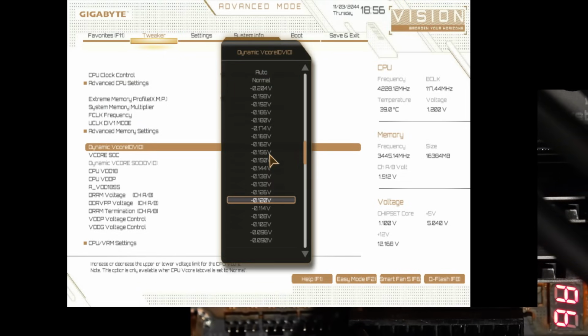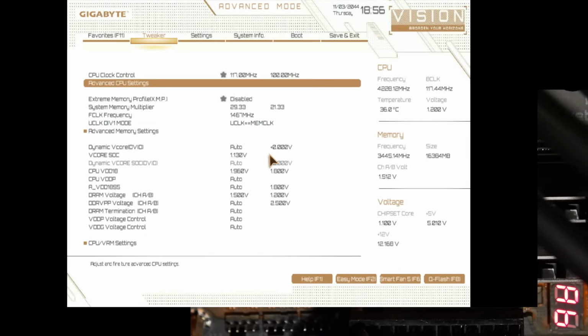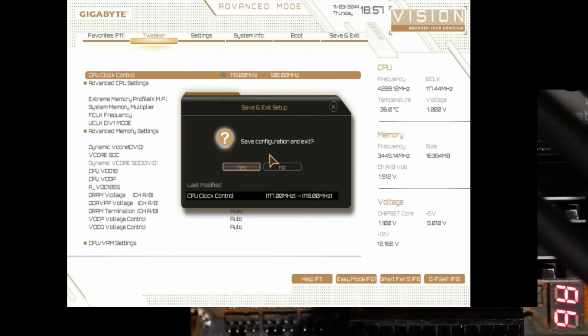Yeah, as soon as you touch it, like I tried minus 50 millivolts, and the CPU immediately lost a bunch of performance. This has been my eternal frustration with AMD's boost algorithm. It runs way too much voltage, and there's no way to tell it to just raise the clock, right? Because the curve optimizer doesn't actually tell the CPU to run at higher frequencies. It just tells it to use less voltage, which you don't get a curve optimizer on the X3D chips.